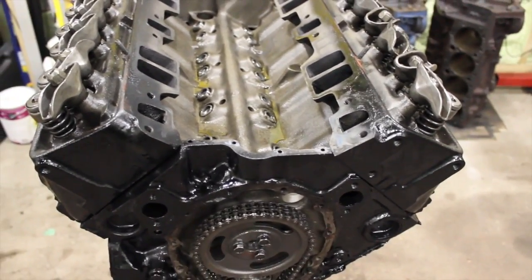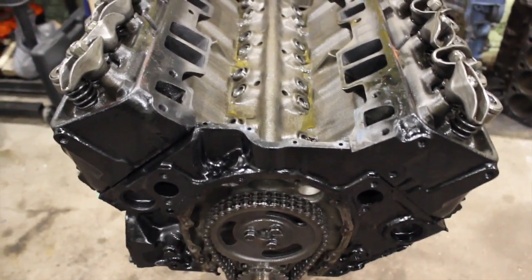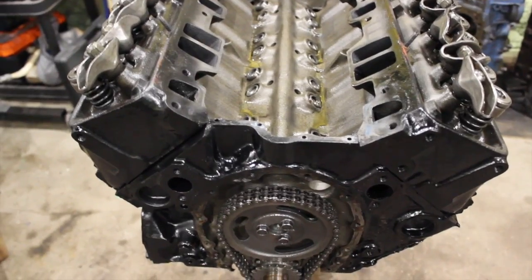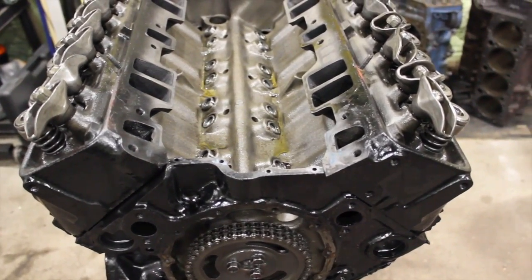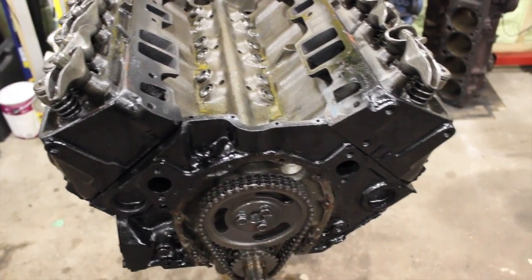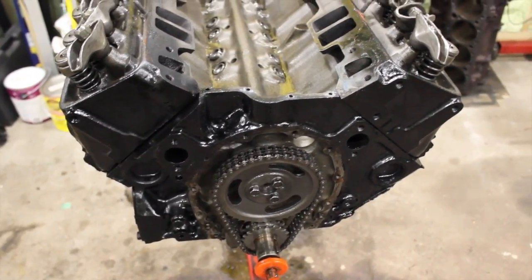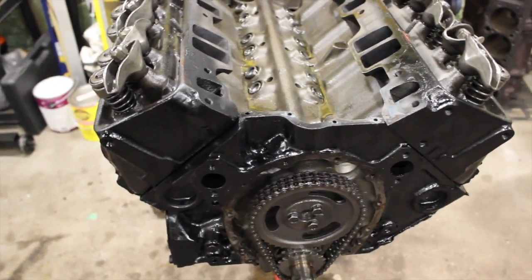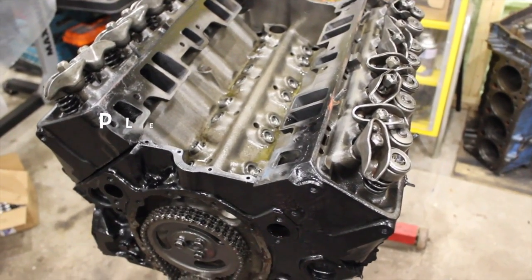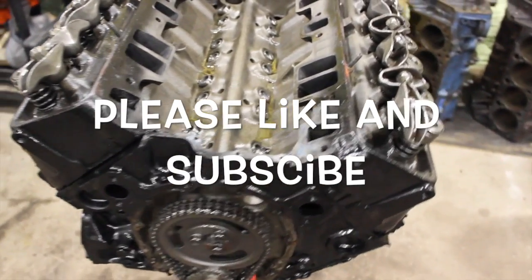When you break in the cam, follow the manufacturer's spec. Keep those RPMs up — don't let them idle. Make sure you prime the motor. Make sure you run ZDDP oil, either a diesel oil or an actual engine break-in oil and additive. Super important — and not just for break-in. Keep that good oil in all the time. Every oil change on your hot rod, keep that cam alive, because the newer oils don't have those additives for flat-tappet cams anymore. Next video we'll be checking pushrod length, so please like and subscribe if you're interested in learning how to quickly check pushrod length on your small block Chevy.